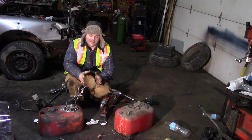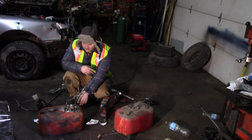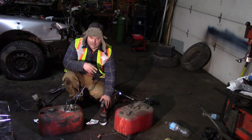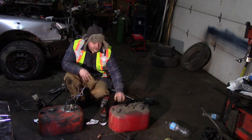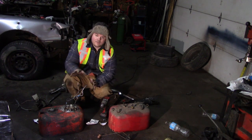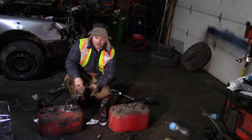These tanks last a pretty long time. The only things that really go wrong are sometimes the seals go in the bottom of older, rustier ones, or you tighten it down too much and crack the material around the cap. Believe it or not, the most common problem I have is leaking around the gas cap - it's pretty hard to get seals for these, so I try to make them out of rubber. The other option, as you can see on this one, is a welded-in bung with an allen key so you need a tool to remove it. All in all, for about $30 and maybe 35-40 minutes, we've built ourselves a tank that can run a lot of cars.